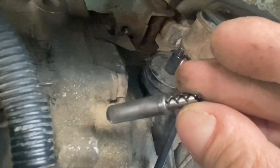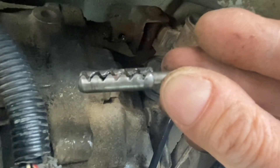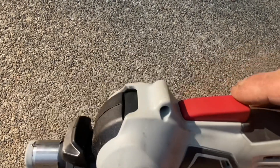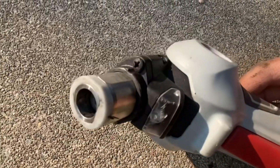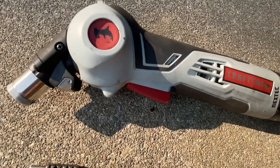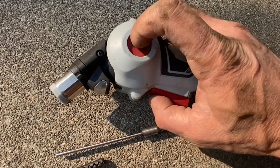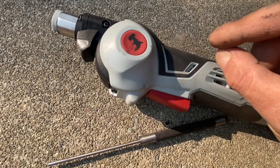This is a roll pin assembly - actually a two-piece roll pin. There's a smaller inner diameter roll pin right there, as you can see on the right side, and then there's a larger roll pin. The smaller one is still stuck in the larger one slightly, so basically you need to pop out the smaller one first, and then you can pop out the larger roll pin. For a quick tip on getting these roll pins out - I actually like to use one of these little vibrating tools. This is actually a vibrating little nail installer from Craftsman. This one has a pivoting head so you can pivot it by pushing this button, and when you push the button there's a little vibration that takes place on the inside. This little nail installer with a small vibrator and a little drift like this works perfect to take these little roll pins out - it literally pops these roll pins out in like two or three seconds. You just have to have the right size drift and one of these little vibrating nail installers. It works great every time.